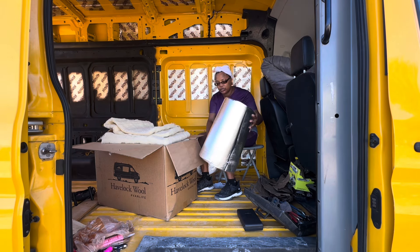I highly recommend Havelock wool even though it's a bit expensive — $150 a box and the shipping and handling is also expensive. I have it folded over twice, just the way it came, and stuck a whole bat into each section. This gives me insurance that I'm going to be cooler in the summertime and warmer in the wintertime. I highly suggest trying this method: sound deadening, then heat radiant, then doubling up your insulation — especially if you have a Ford Transit, because those walls are thicker so you have more room to insulate and can make your van soundproof and well-protected from heat and cold.